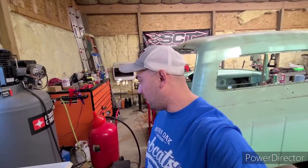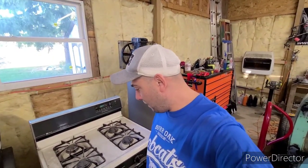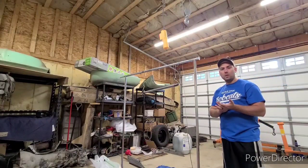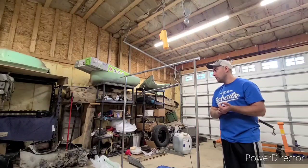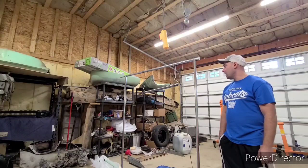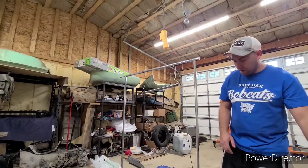Right now, I'm at 225 on my oven, so I'm going to stick this part in here, get the cleaning products burned off of it, and then we'll yank it back out and start spraying. Alright, part just got pulled out of the oven, so we're going to go ahead and spray it with some powder coat. I'll get the mask on, get the voltage turned on, and set air pressure to 15 psi. Powder coat's in, so I think we're ready to go.